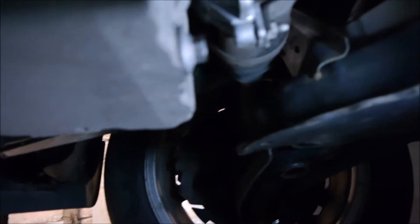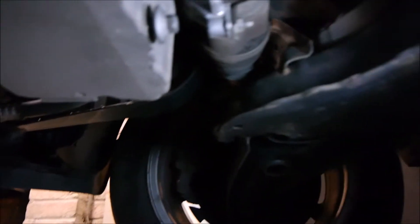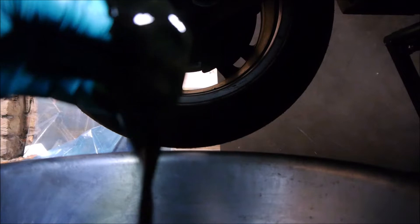This is the next real test — the quality of the oil coming out of the sump. Let me get a clean bucket here. Let's see what this comes out like and hopefully it's not like silver paint. Moment of truth. I got it all over the floor but let's have a look. It's looking black. No magnet on the end of my tool, so that's not a telltale for metal bits coming out. It doesn't look reflective, which is good.